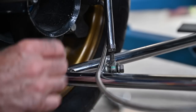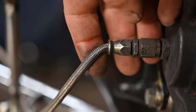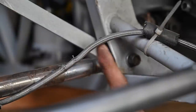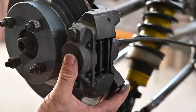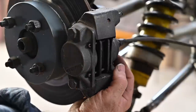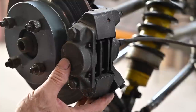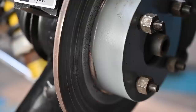On this car the brake hoses have been renewed - these are stainless steel hoses and they still look fairly new, so I don't have an issue with these. I might reroute them though, because this one is sitting in a way that bends the top part. You can actually see it's a bit bent here because of that rod in the way, so it's better to reroute those. I noticed that some of those flex hoses are damaged, so in my case I'm going to replace them all - that's the safest way to repair this car.